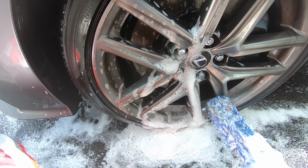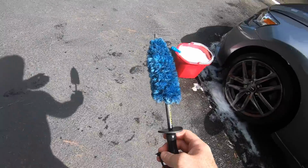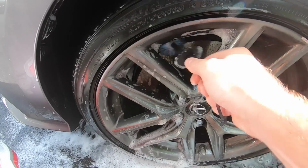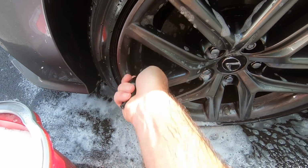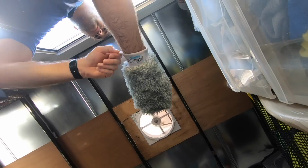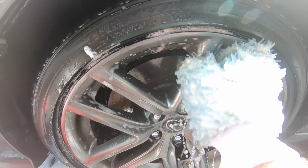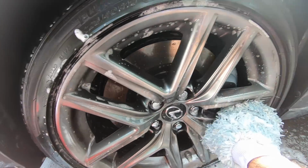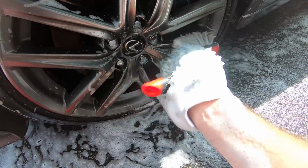Our process begins with a thorough rinse and APC rinse. This is the pre-wash phase that will remove the majority of the heavy grime and dirt particles on the paint, wheels, and tires. You can use any APC or degreaser you want, diluted either 10 to 1 or 4 to 1 for heavy cleaning. I have some options linked in the description below, so check them out. We also pre-treat the door jambs with APC and flush them out with the pressure washer.